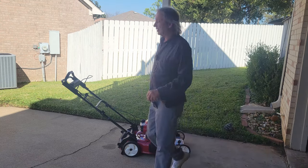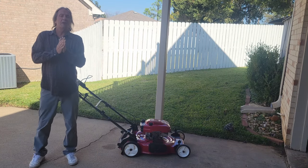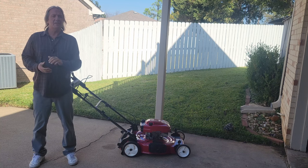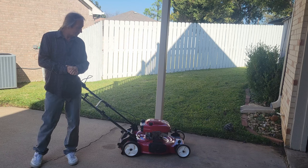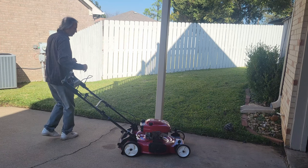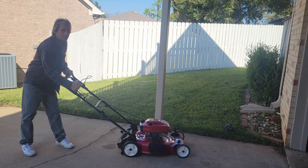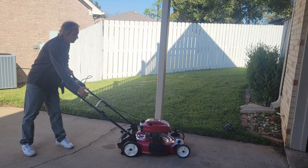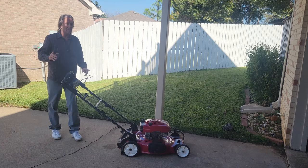You might want to check your blade — it might need attention, and it may have been bad for the blade when it happened. But let's suppose you've just pulled it out of the shed and you're getting ready to cut your yard; there's probably nothing stuck in the blade. The next step is if you go over and pull on it and it just won't pull — if you're getting some pull on it, then you know your recoil mechanism is probably okay.